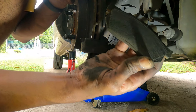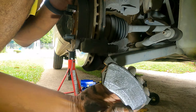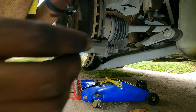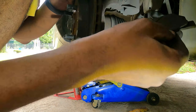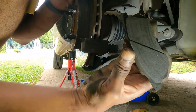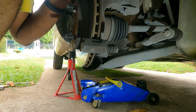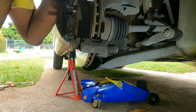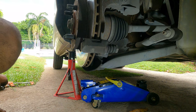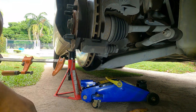This brake is done, done, done - the wear indicator line is done, this warning indicator here is also gone. So for this particular brake caliper assembly it's going to be the same treatment, in which we roll this back in.